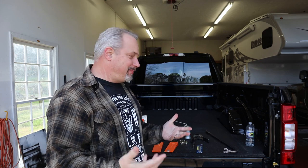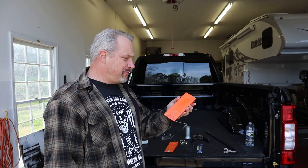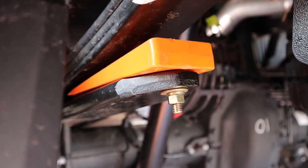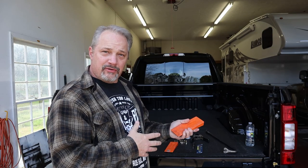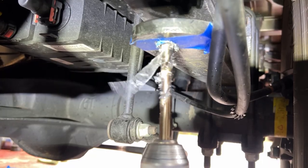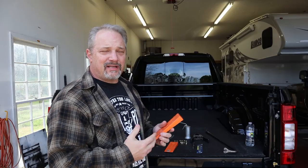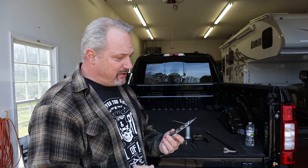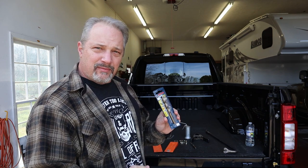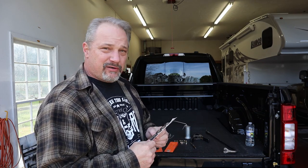Over the past week, I decided to go ahead and pick up a couple more wedges. So these are my old ones here. But I've already installed the new ones on the front of the springs. And this being a Ford, I did have to drill out the holes on the leaf springs. I've drilled out three of the four, so I'll show you how I do the last one. It's really not that hard, as long as you have the right drill bit and a good slow speed on your drill. I did end up buying some Bosch cobalt drill bits from Amazon and those worked great.